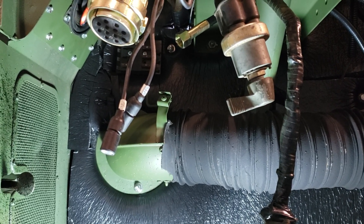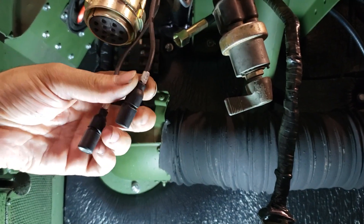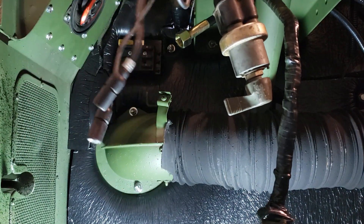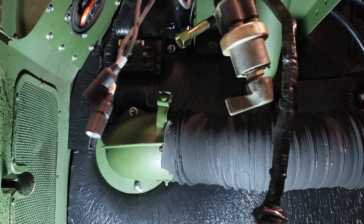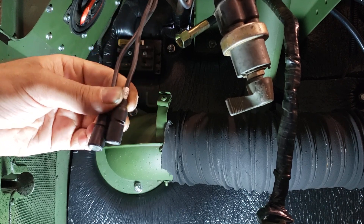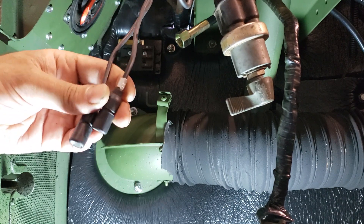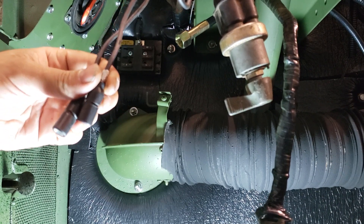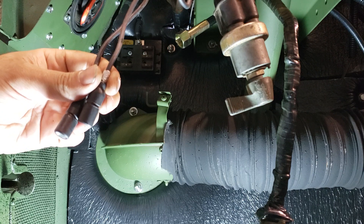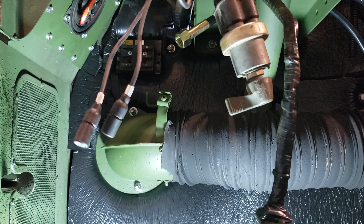In this case, we've got two Packard connectors. These are number 55. These go to the in and outside of the switch for the flame heater. We don't have a flame heater on this truck, so this is actually my field wire for the alternator. What I'm doing is connecting these two together and allowing another lead to go to the switch and from the switch to something else.